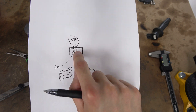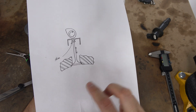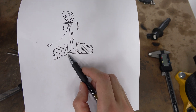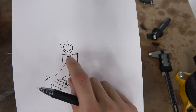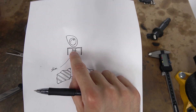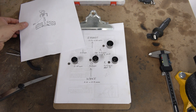To remediate that, what we can do is lower that bucket by having a shim that is thinner. Because that valve is not going to change, that bucket is not going to change — but to change that gap, we need to have a shim that is smaller. So we keep that example — we have that shim there that has a number on it but it's really worn out. It's not really a problem because we just need a caliper. I'm using a common caliper here and I'm going to measure it: 1.79 millimeters. Just turning the shim a little bit every time to show I get the same measurement. 1.79 millimeter thick for that shim.